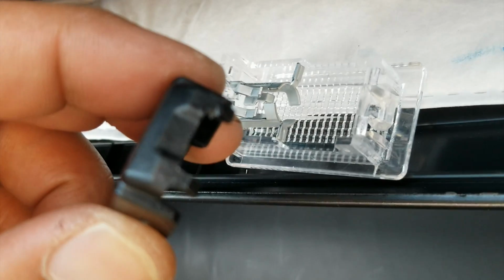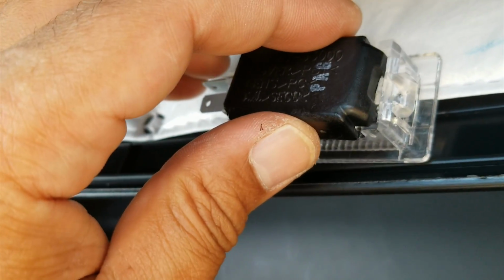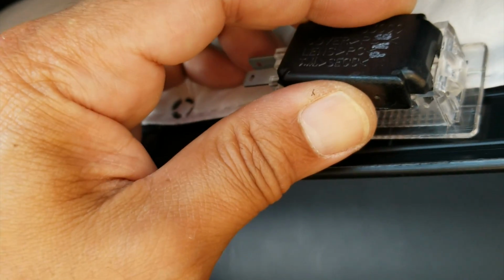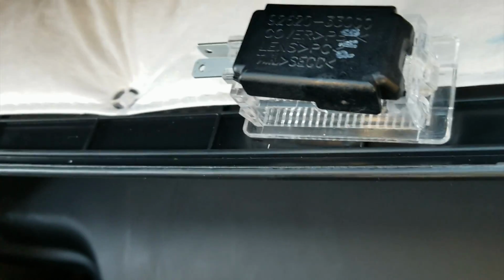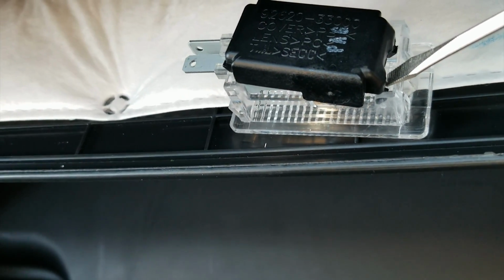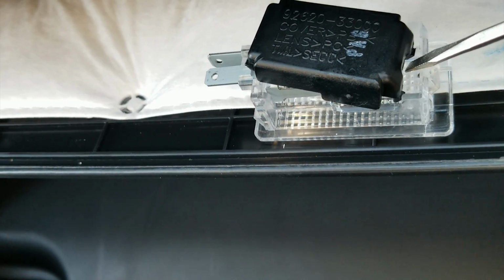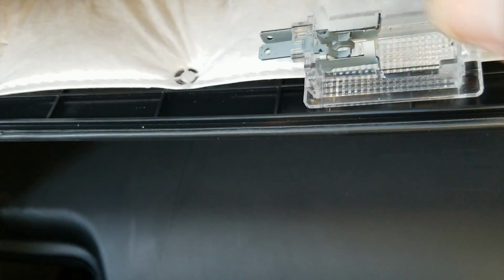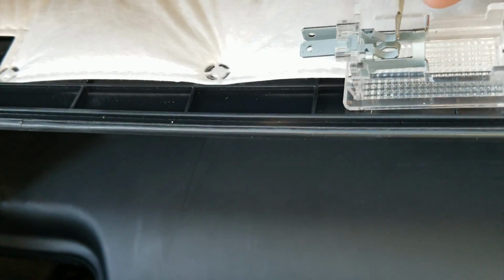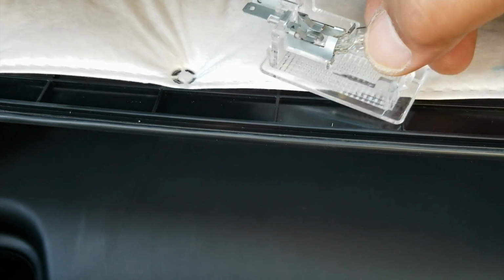And these guys have little teeth on them. And they grab right in there. So it just snaps into place. So you got to go right in between. Let's see, right in between that carefully. It was kind of tight. And then pry upward gently. And then I use the same tool to actually grab it right there and push the bulb out, which is, here's the factory one. So it just sort of slides in the channel.